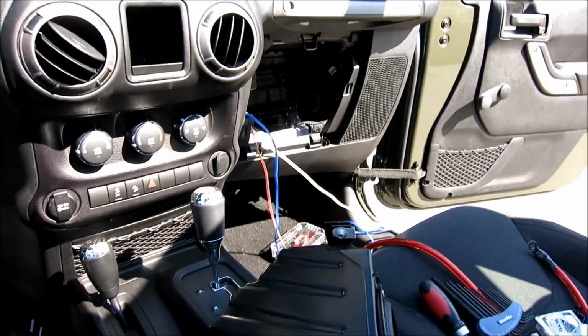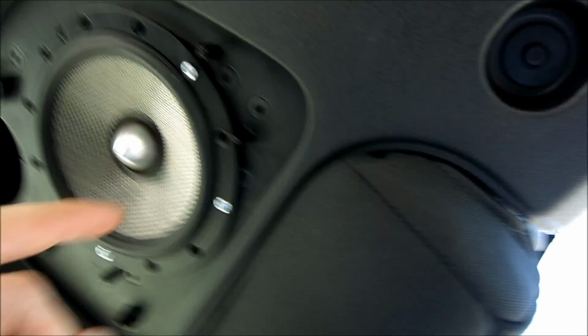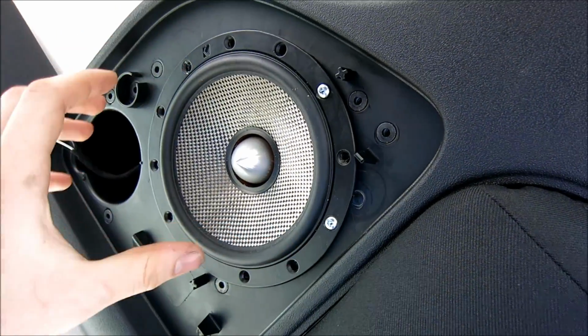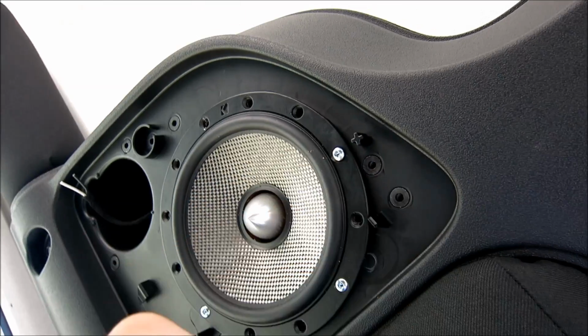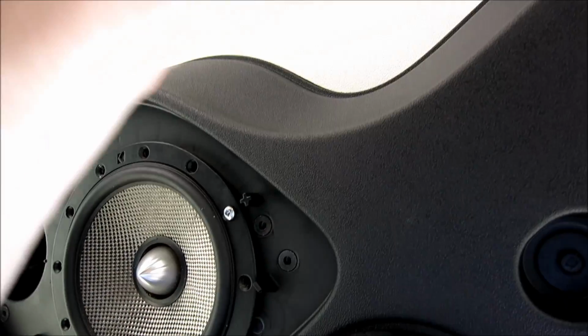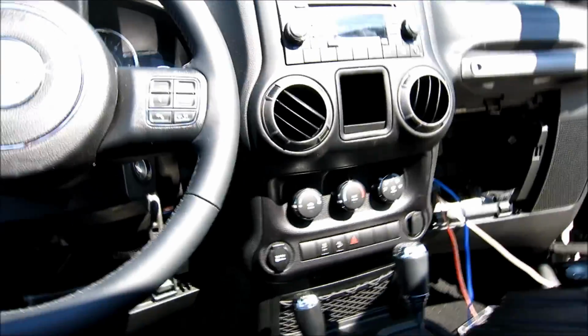If you've got big crossovers like the Holy Bible, like I've got right there, I've got to run a fresh wire from my tweeter along here, or my woofer through here, and then down, and same with over there, because I can only utilize one of these, and that's because I'm not putting my crossover in here, so I have to have a wire for my tweeter and for my woofer. So I've got 4 wires, and then plus from there I'll do an input wire to the amplifier. All good and fun, right? Alright, cool.